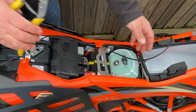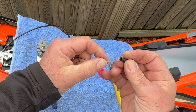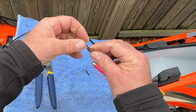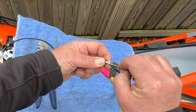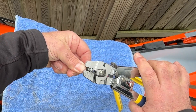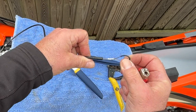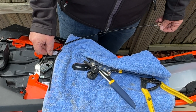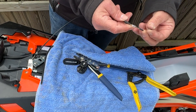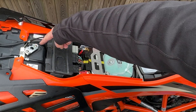Remove the inner so that you don't cut through it. Cut the cable outer, push the inner back through and check that it works. I left about three inches on the end — that's the ferrule that would normally go into your rear derailleur. Put the swaging kit on with a little bit of heat shrink to make it look neat, pop it back through and give it a little crimp. However, I've made a little mistake — I've actually pulled the other end out of the fitting, so it's a little bit short and there's a little gap at the end. Rather than shorten the cable and start again, we get a little bit of the swaging kit — it's just soft aluminium — and pop it onto the cable there to take up that slack so the other end can't come out of the fitting.